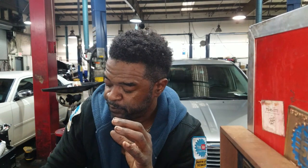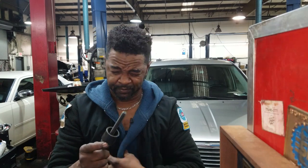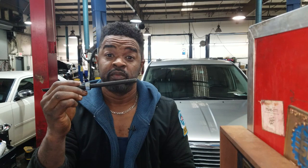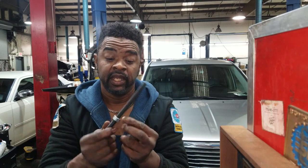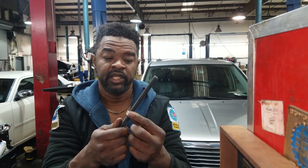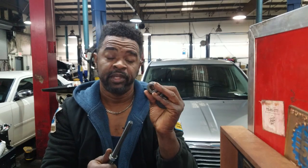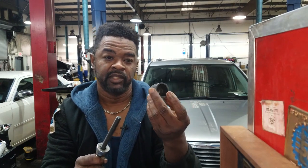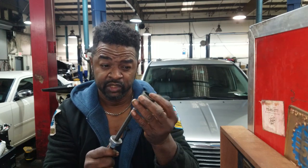There's a special tool for that, but you don't really need a special tool. Here's the Miller tool that I use. But if you don't have this, don't panic — simply make you one. All it is is a long bolt. This bolt is the same thread as the crankshaft hole, so you screw it in there, but get yourself a nut first that would thread on the bolt. In this case, there's a roller bearing right here to aid in turning. This is a Miller special tool, but you can easily use a socket the same size. That's used to press the pulley on.